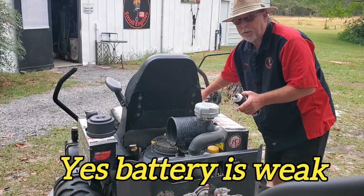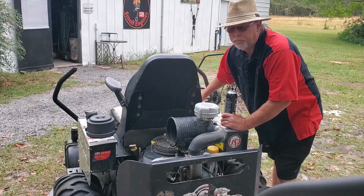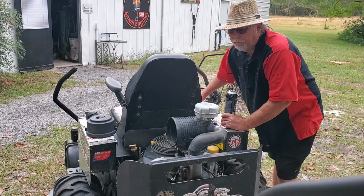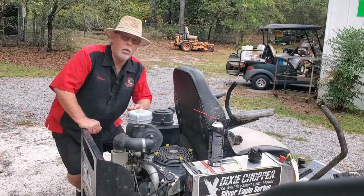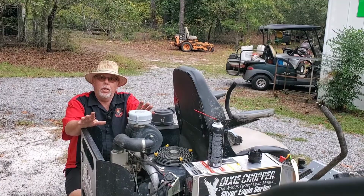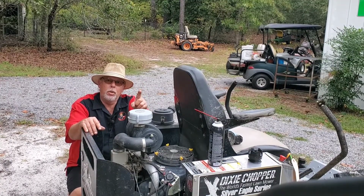Let's try to start. You hear that? Let's try it again. Ready? Runs and dies. So what we just did, now we know we got fire, we got compression. It will run. So it is a fuel issue somewhere.